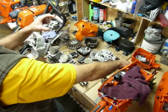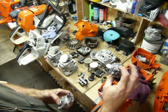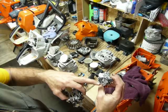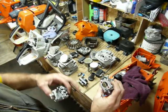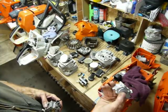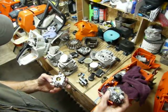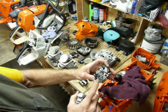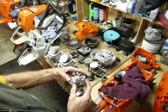If we look at the carburetors — 19-millimeter Venturi on the 395, and 18-millimeter Venturi on the 661. The 395 does have stops. They came with Tillotson carbs, but now they're sporting Walbro. This is actually a Walbro carburetor — an electronically metered fuel system based off the speed of the crank.